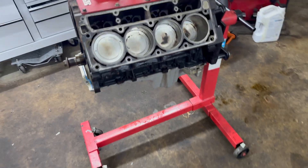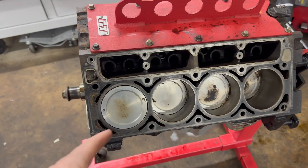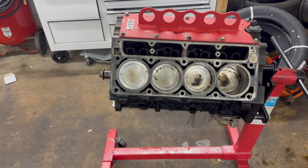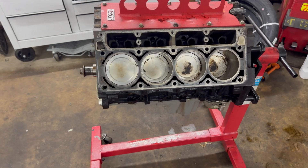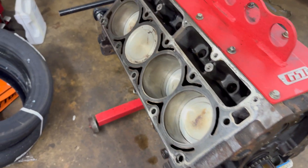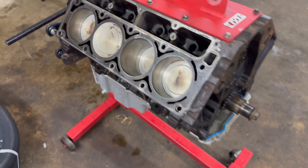It's going to be really hard to see on camera, but I ran my fingernail through it just to see if it was a mark in the sleeve or an actual crack - it was definitely cracked. So because it was cracked, he went on a mad hunt overnight and found this 6 liter. This is a Gen 3 motor. We're not doing anything crazy with this - it's basically a cam-only deal, something for him to have fun in. Got this thing torn down - it is very clean. We were told it has 113,000 miles on it, and I don't doubt it. I did clean up the tops of the pistons a little bit; they just had some carbon built up. We're going to wind up pulling the cam and valve train and heads out of that motor and putting it on this 6 liter. We do have new lifters, new head gaskets.